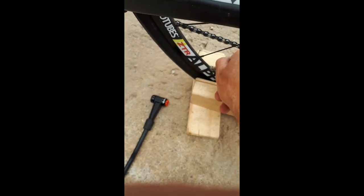Let's take this off. A couple of rides ago I pumped it up to six bar, and only a few hundred meters later the cut broke and milk was spraying out. It took about a minute or two until it sealed. I stopped, made sure the hole was at the bottom, rotated the wheel once or twice, then put it at the bottom again.